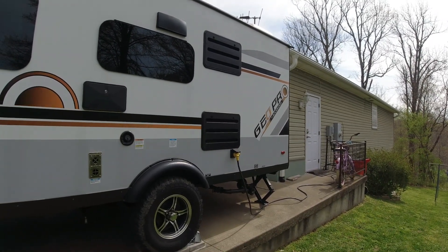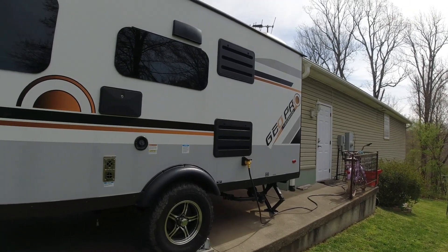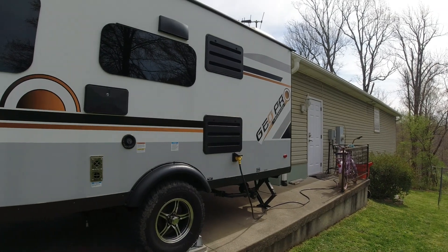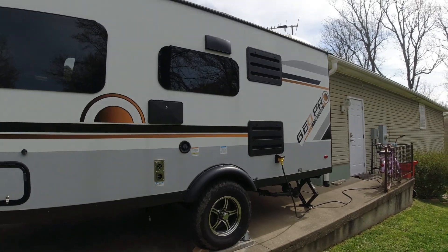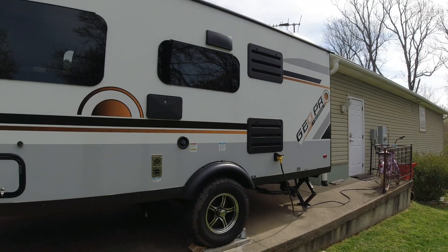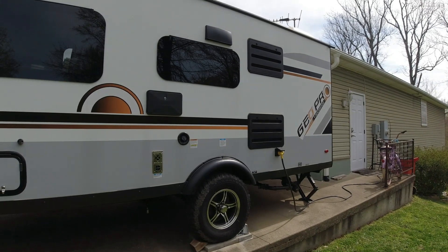This is the model with the LP refrigerator, which will make a big difference. If you're trying this type of system with one battery like mine, you may need more. If you have a 12-volt refrigerator you may need a 200-amp setup, but we're hoping that this 100-amp will work for this particular situation. We also only have the 100-watt solar panel on top.